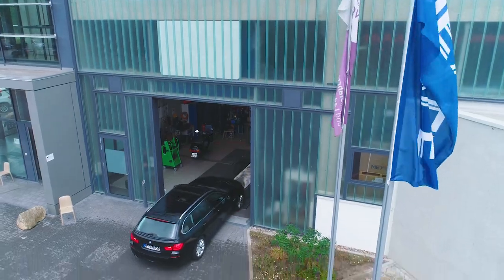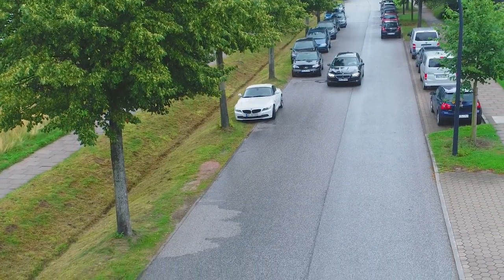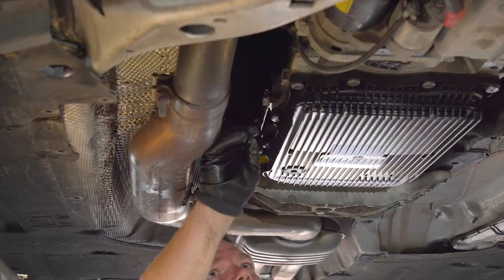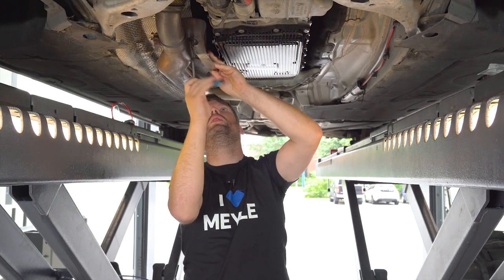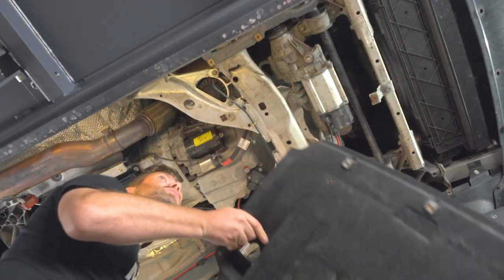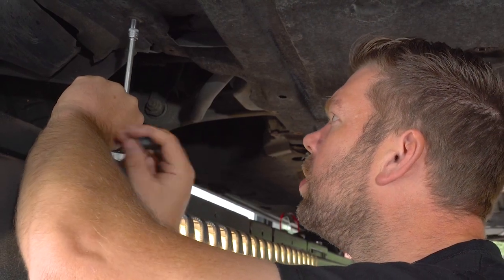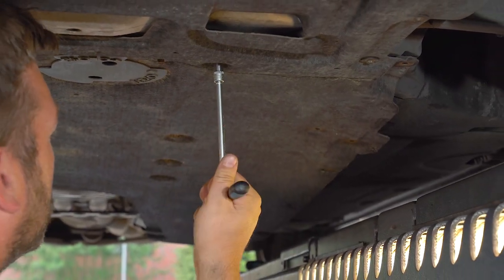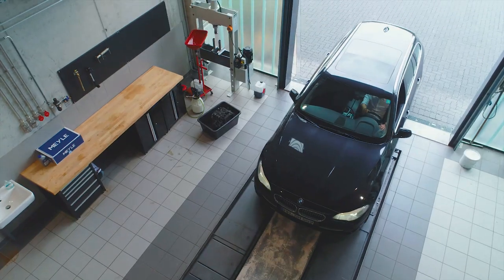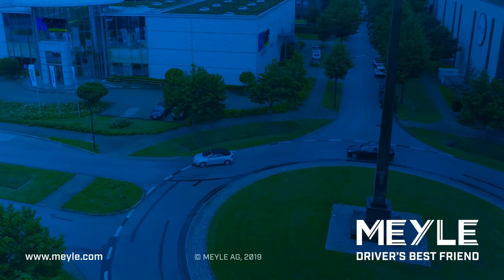As you saw previously, it's dripping out quite a lot. To open up the oil cooler thermostat, we must bring the automatic gearbox oil temperature up to at least 75 degrees. Afterwards, you must check the oil level and top up if necessary. After completing the automatic gearbox oil change, you should take the car for a test drive.